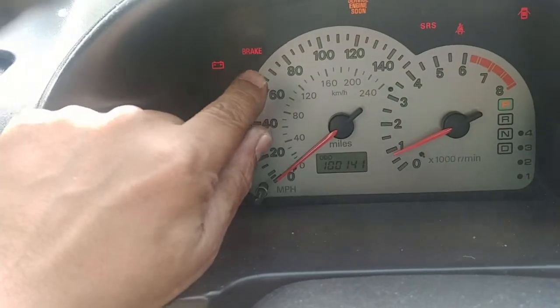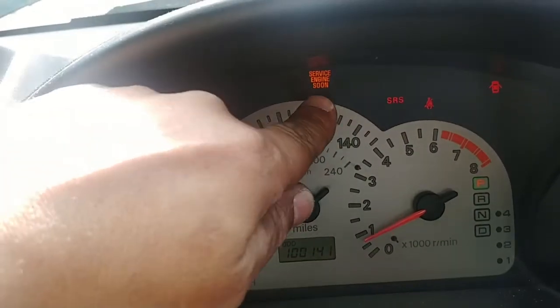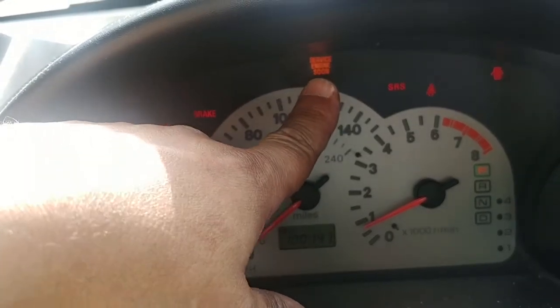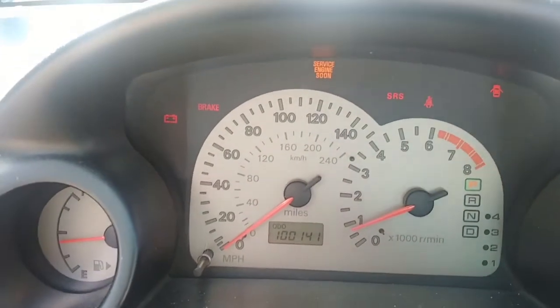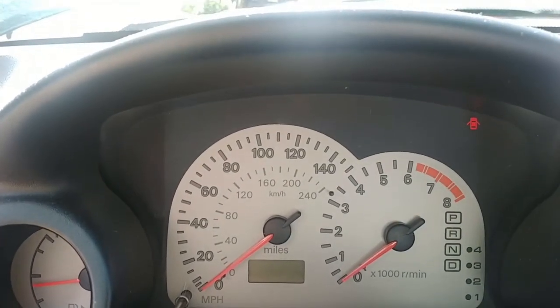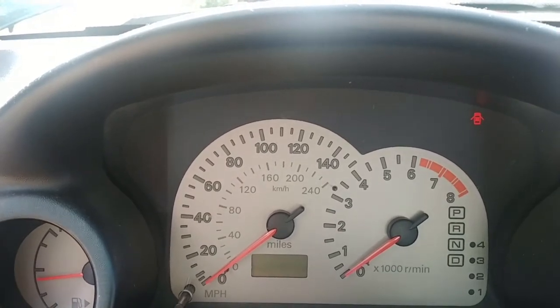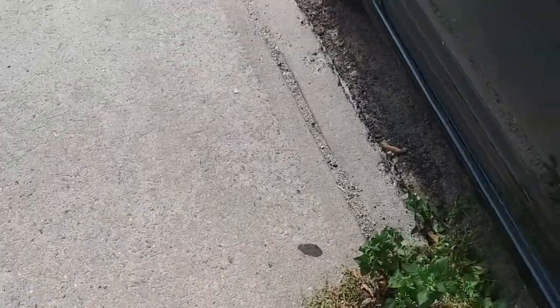You can see the little battery indicator is on, and also the brake light is on — this one just came on as I was driving while looking for a good location. I think this is still cylinder 5 that's misfiring, which I've got to look into, but the alternator is dead. I recharged the battery last night so I could get some voltage out of it and move around, but now I've got to put back the new alternator. Like I said before, I was predicting the factory alternator was going to go bad, and it eventually did.